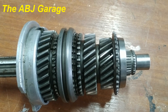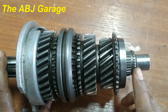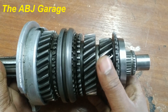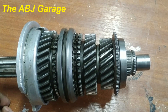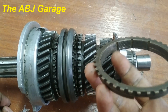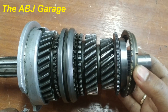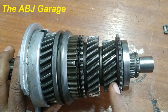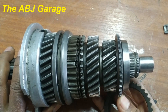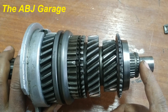When we look at the main components of the synchronization assembly, we have the output shaft which is going to the propeller shaft. We have the speed gear that is riding free on the output shaft. We also have a synchronizer ring — this synchronizer ring has a friction material on the inside; there are also synchronizer rings which have friction material on the outside. This gear is connected to and always in constant mesh with the counter shaft, but it is supported by a roller bearing, so it is riding free on the output shaft.